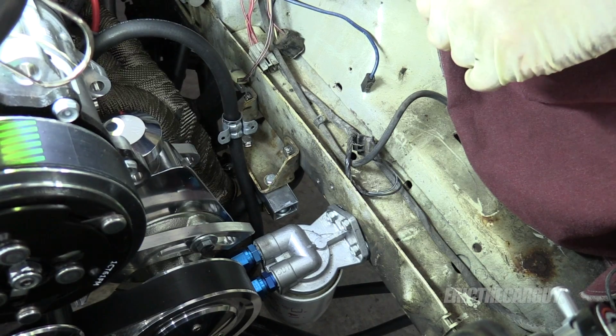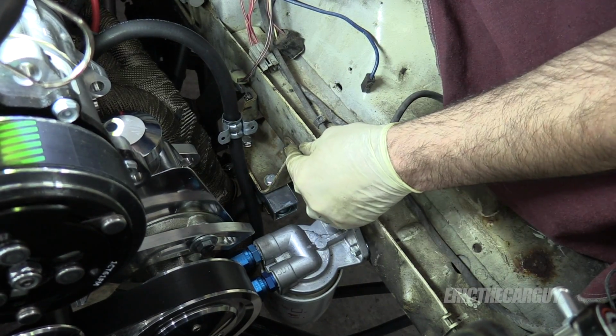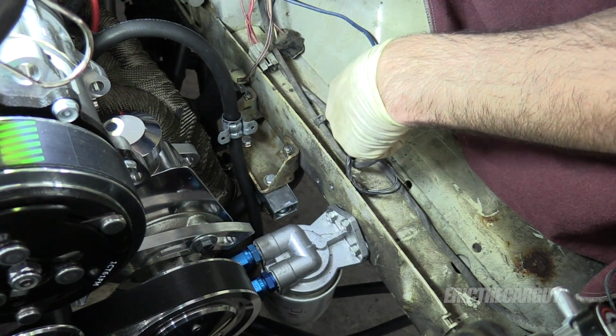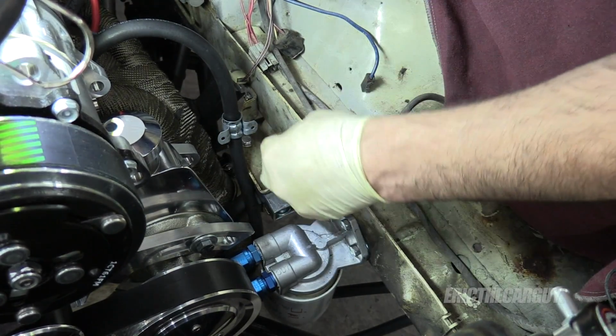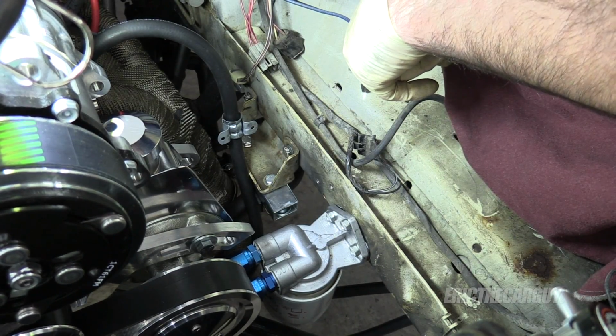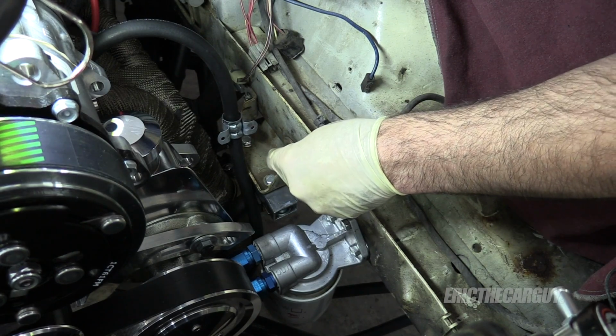Going with different fasteners this time instead of the pointy ones. I'm going to go with these, because this will go up into here, and there will likely be this washer tube and wiring harness there as well. And if I have sharp pointy screws sticking out here, there's a chance that that could damage that wiring. So this time I'm going with a different size screw.